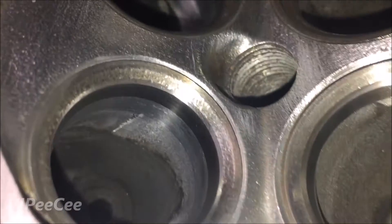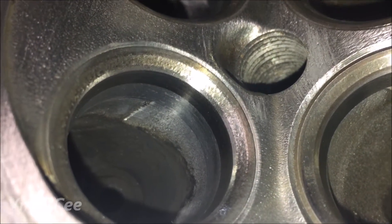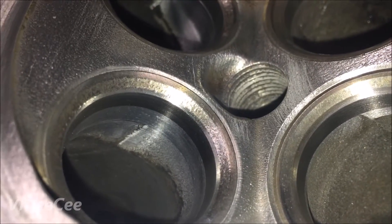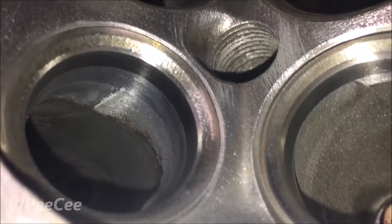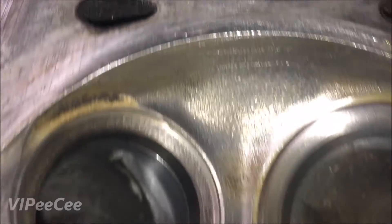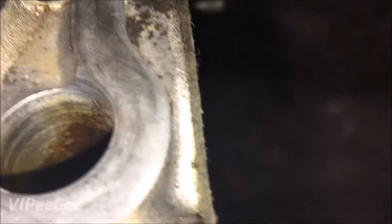This one is in just a little bit better stage of polish, but those valve seats are pretty well hashed. When you have burnt valves, everybody just wants to go out and buy new valves and slap them in — well, that's the mating surface you're slapping them into. If you think that's gonna seal, you're mistaken. That's just the way it works.